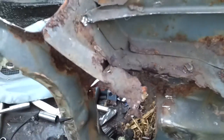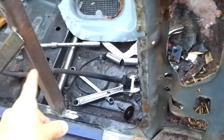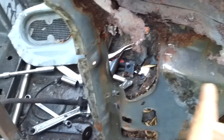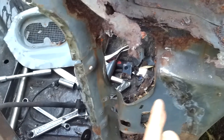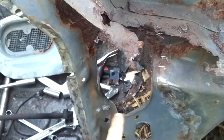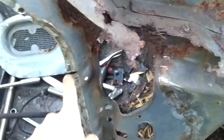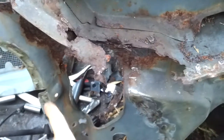Once you have that bracing in, then you can start taking out the pieces that you need. Once you get the new one — or fix the old one, however you're going to do it — do the inside first. Get all your measurements. I have my measurements for my door mounts and I marked them onto the post so I can make sure that the outside piece is right where it needs to be versus too far forward or too far back. You need to come up with some reference points depending on where you cut the inside piece. I'm trying to leave as much of the original stuff there as possible, so I'm going to stay up high and then just do this L part of it.